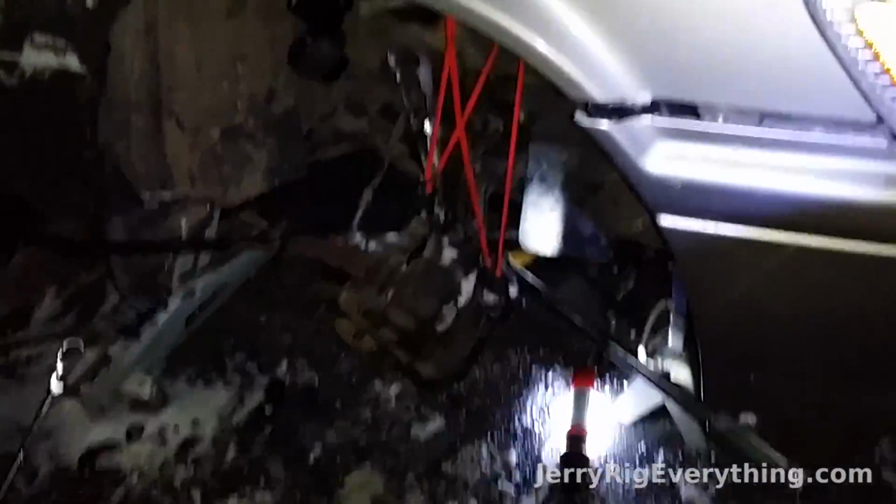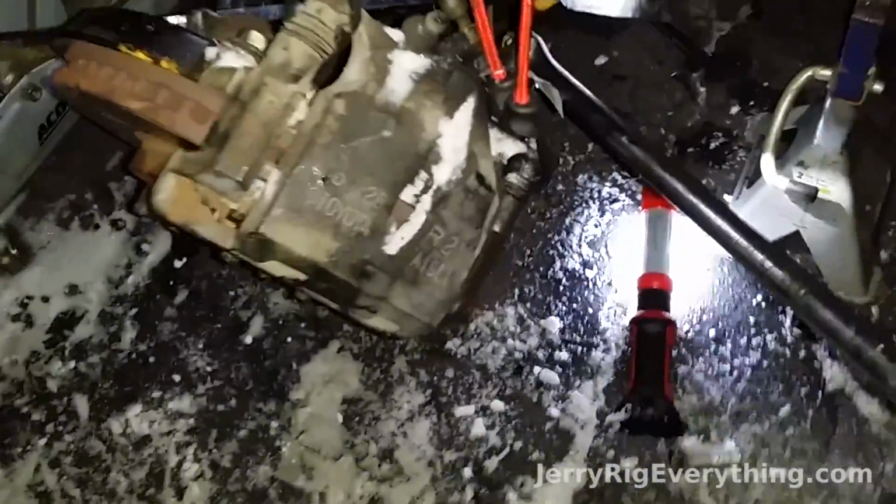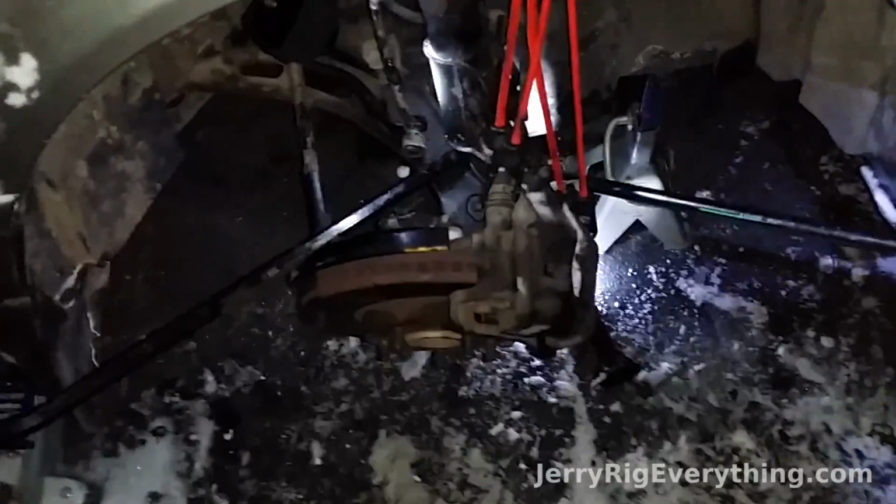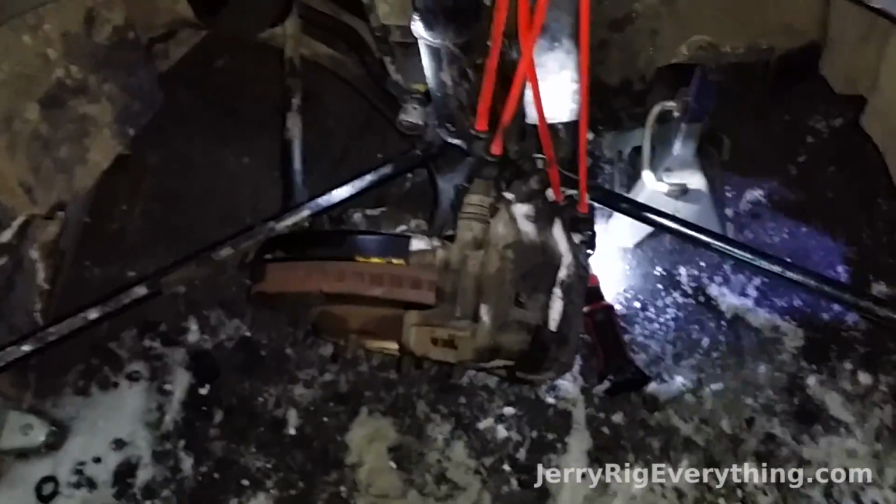So as I'm trying to do that lower nut on the caliper where that ratchet is, right here, the breaker bar, I had to take the crowbar and pin it underneath the frame down in there and over the top of this joint right here, and press down on both of those at the same time to get the right leverage that I needed. So yeah, it's working out pretty well.